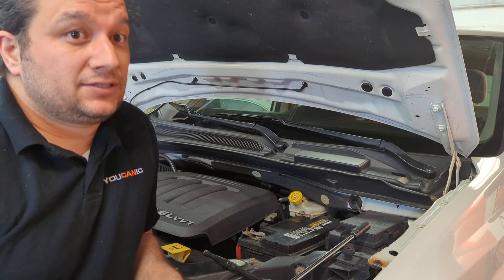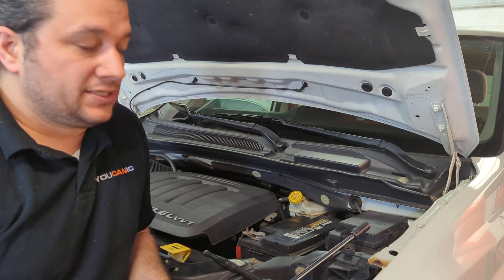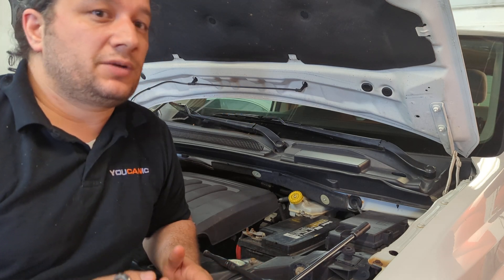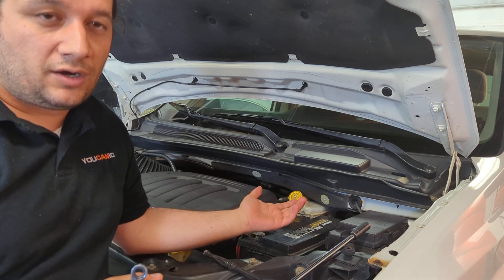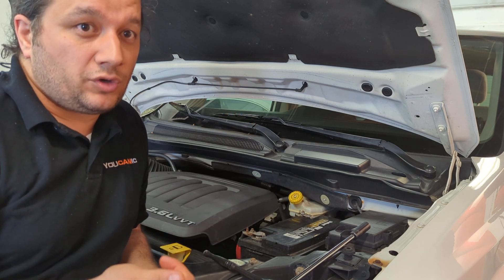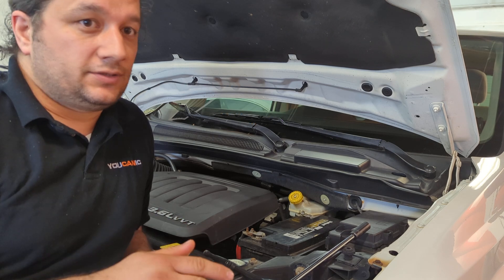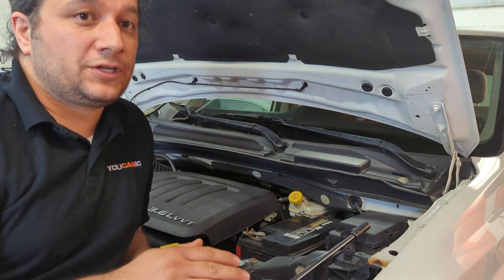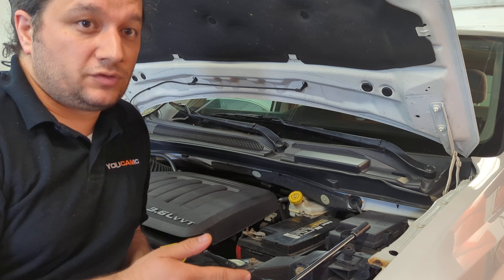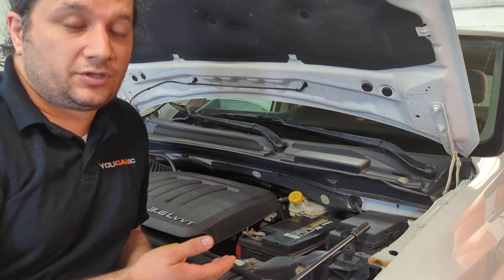Those minor inconveniences are small compared to the issues you might cause by keeping power to the vehicle. If you use a jump box to maintain power, that jump box might only output around nine volts. If you turn on the ignition with that low voltage, it's going to throw a bunch of codes in many modules — especially in European cars, you'll get several low voltage codes across various control units. Some will clear once you reconnect a fully charged battery, but airbag codes in the airbag module caused by low voltage won't clear on their own — you'll need a scanner to clear those.